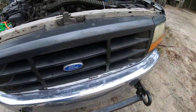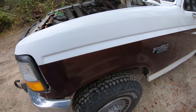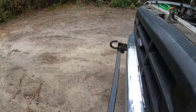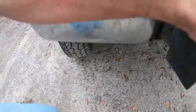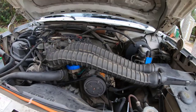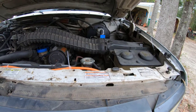We still got the wheel speed sensor issue. I actually worked on this truck long before I owned it, before Matt owned it. I'm pretty sure — I think it's the other side — one of the caliper clips had broke and fell out inside the rim. There was a pretty good scratch inside the rim, going round and around. Imagine that wheel speed sensor; if I had to guess, that's probably where it is. But we'll deal with that later on.